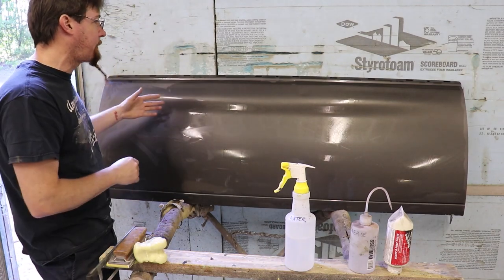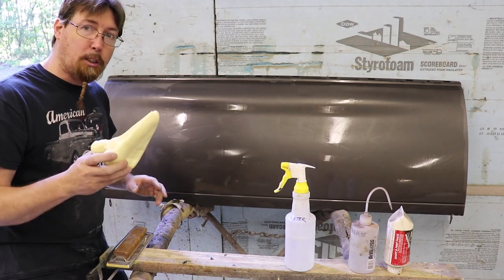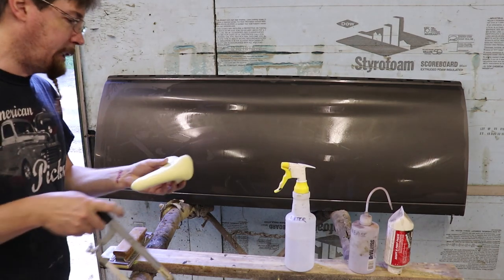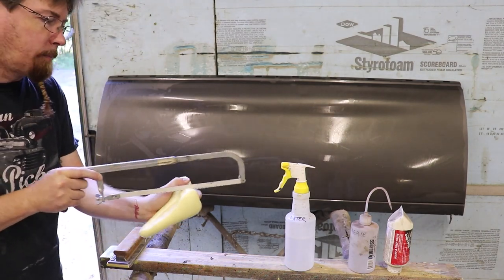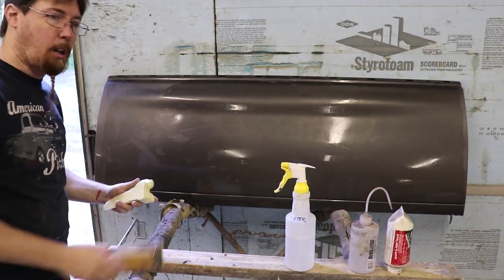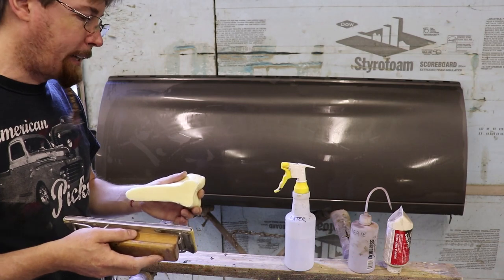The tailgate is basically ready to go — it's ready for clear, but we just can't go sanding and sticking stuff on there. These are Nightmare Makers rigid foam bones, and this is a non-sponsored video — we just really love their product. I'm just going to use a hacksaw to cut this stuff. I'm going to use just a quarter of the bone because I'm doing skull and crossbones, a classic pirate motif. It cuts super easy — you could use a regular wood saw, a sawzall, just about anything. Then I'm going to take 36-grit and flatten the back out. This gives me a nice tooth for the short-strand fiberglass to bite into, which is what we'll use to glue it to the tailgate and mold it in.